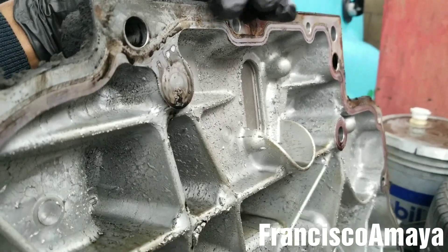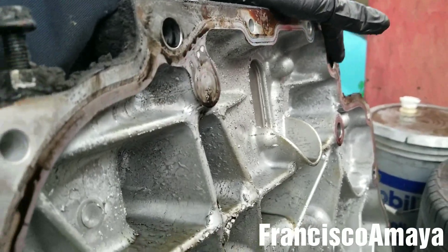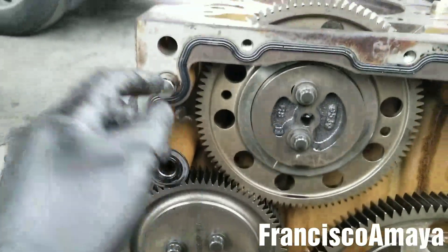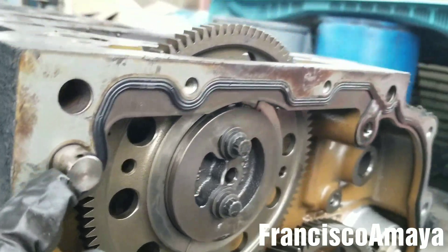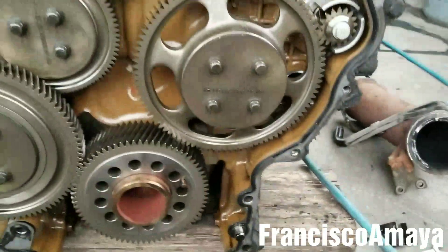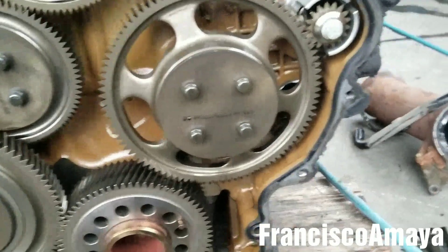Be careful whenever you are trying to pull it out because this is aluminum. Try not to pry hard on it because it's really hard to get out due to the guide pins. These two guide pins here stand out pretty far, so be careful when you are prying the cover out because you can damage the aluminum housing.